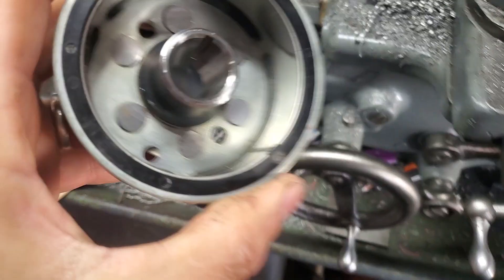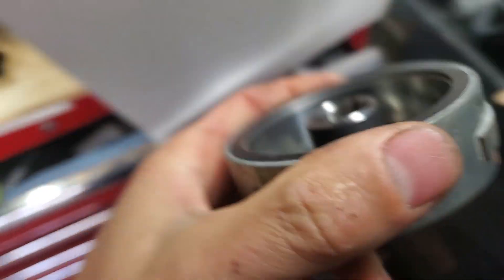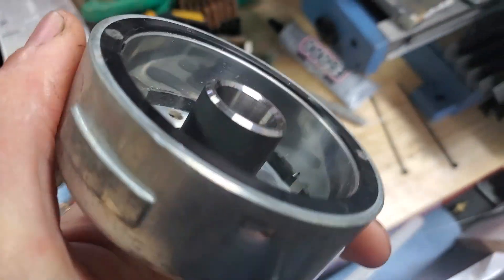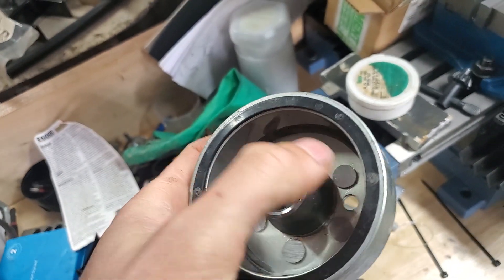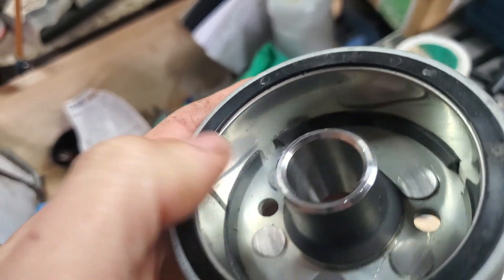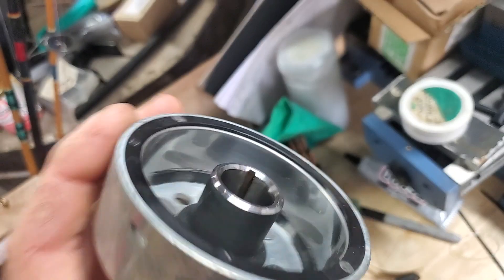The other thing I did was put the flywheel in the lathe and turned the backs of these studs down 30 thousandths, which equates to about 0.7 millimeters. I think that's what originally took this bike out, because when we were in the desert I kicked it and it just didn't sound like there was any spark. While I was turning this, all the shavings were piling up on the bit holder and rubbing along the inside, and they ended up polishing that — it looks really cool. I never touched it with the lathe, but the chips kind of piled up on the tool holder and it actually came out looking pretty sweet. Of course, I had to pick all the metallic bits out because it's magnetic.